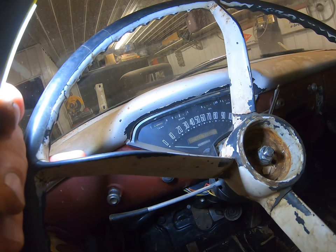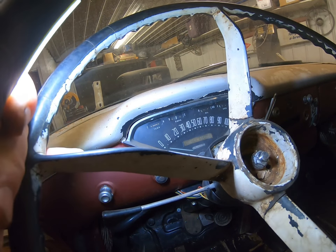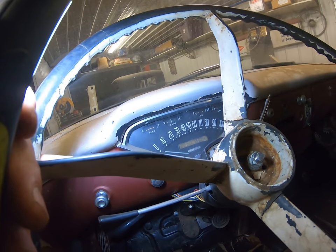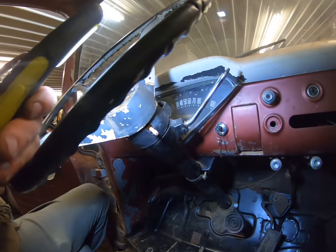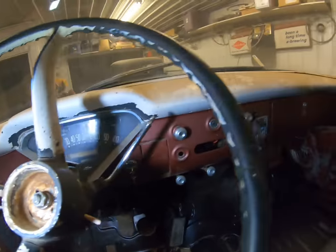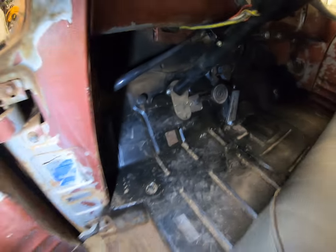The headliner's still in it, though it's missing the dome light cover. All the gauges are working — oil's mechanical, fuel gauge is working. I didn't hook the amp gauge up because I just don't like amp gauges; basically you're running the wire that powers the complete pickup through there and you hear lots of horror stories. The temp gauge is hooked up and the speedometer cable is hooked up — it's actually the same length and same threads, but something must be wrong with the cable because the speedometer is not working. I like columns that don't have the ignition switch on it — factory stuff. He didn't want to buy an aftermarket column and had this Dodge column laying around. He doesn't want to put a heater core in it yet. You can see I put the floors in — that's where I seamed them all together, they came out pretty good.